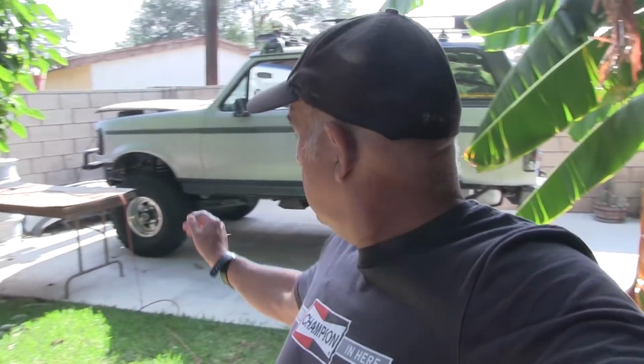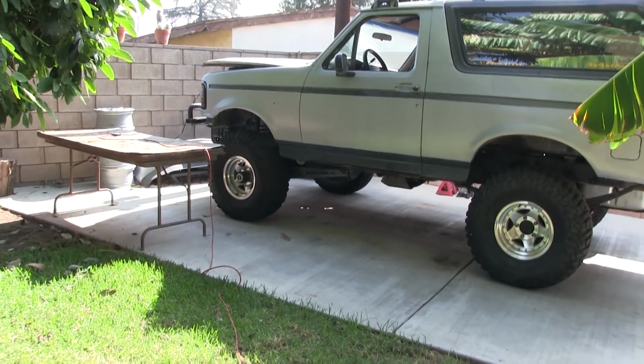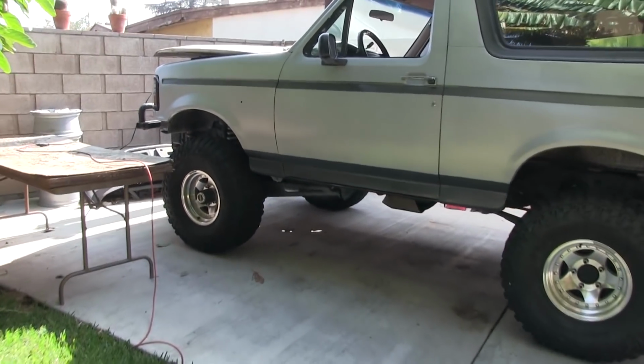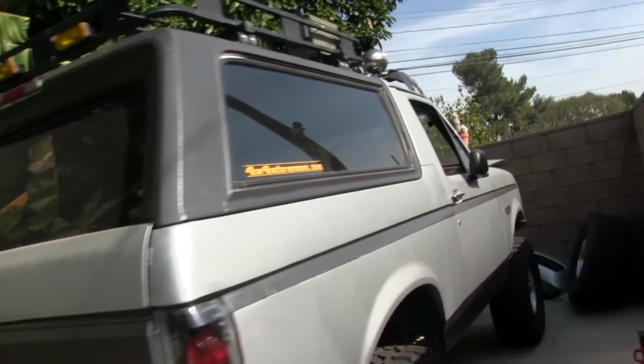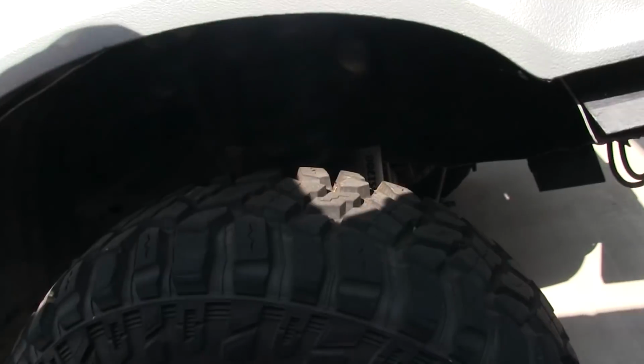And the story I got was that's because the camber adjustments are topped out, they're maxed out. They put a camber kit on it. So if your springs are setting too high, it's beyond the adjustment capabilities of those camber bushings. I mean, they do sell aftermarket camber bushings. I'm sure Rick put them in. But if I remember right, I had the exact same issue with the Pro Comp springs in there. Because I remember they did have to put the camber bushings in there and they were maxed out. And it was basically a matter of time for the springs to settle down a little bit, and it got better as the springs lost their springiness, I guess you call it.